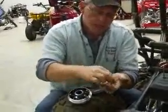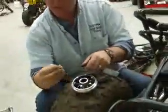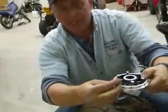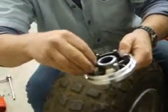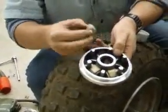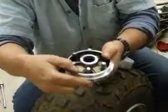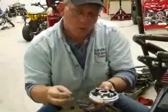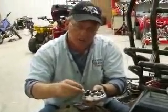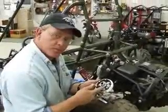The sliders go in a little differently because they're not completely round — they've got flat sides to them. The way you put them in the variator is the long flat side goes up against the inside of the variator, not the two short sides. Put all six in there with the long side against the inside, each one the same way. A DR pulley slider actually reacts more like one to one-and-a-half grams lighter than the same-size round roller.